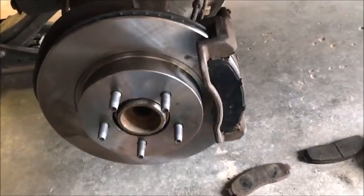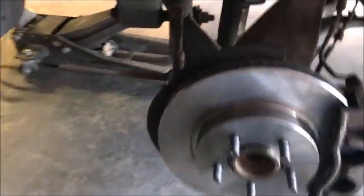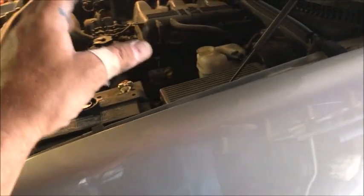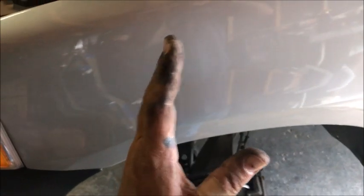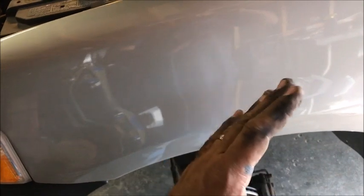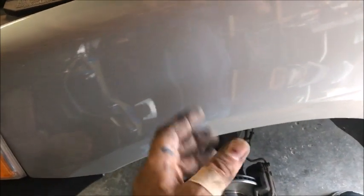Make sure you push the shoes in before sliding the caliper forward, then run your two 14 millimeter bolts and tighten them up. Wipe the new rotor down with a rag. At this point the master cylinder will be about half full — do the other side first. When both sides are done, put the cap back on and pump the brakes down slowly three times — from the top of the pedal to the floor should take about four seconds.